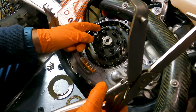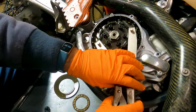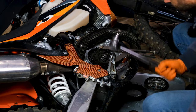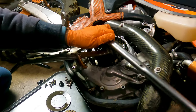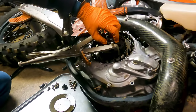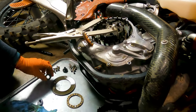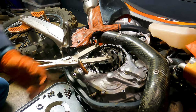These are the spots where the pins are going to sit, so I'm not going to use those to lock against in case I scuff them. I'm going to use these instead. Lock that in there gently — put a little more tension on that and then you should be able to use that to counter-hold and break this loose. It looks like they lock-tighted this. I'm not sure if that's really necessary. There's a locking ring which I think is going to stop it going anywhere.